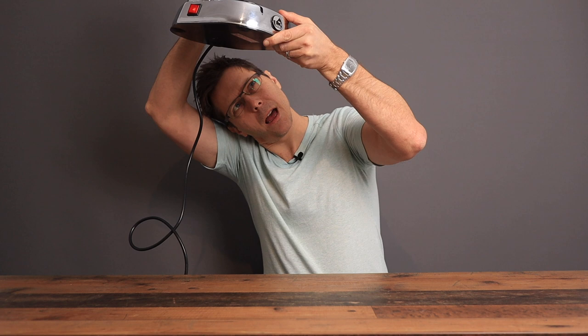It comes with a heating element — don't touch this once it's heated up because it's very hot — 1000 watts. It's got a brew chamber that is 1.6 liters and it's got here on the side a water level indicator so that you know how much water is in here. You've got this water level indicator and on the professional model a manometer for the pressure inside the boiler, which is right around one bar.